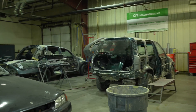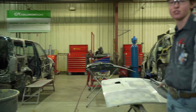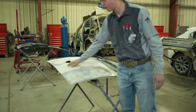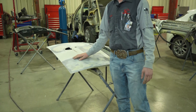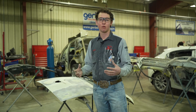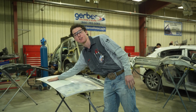Part of our comps are to remove panels — like this is the back trunk on our PT Cruisers. You can also see where we were given dents and we had to go through and pull the dents out, restore that, put body filler over it — no more than an eighth inch — and then when you run your hand across it, it feels just like the original.